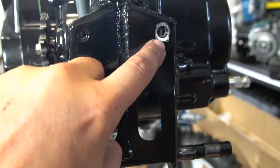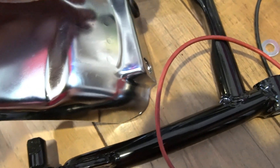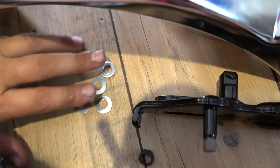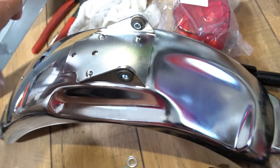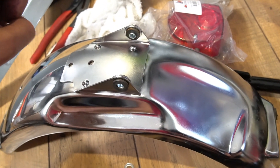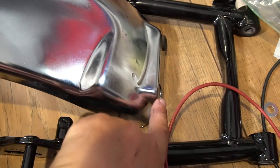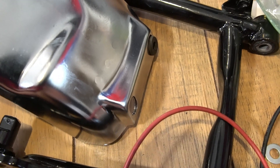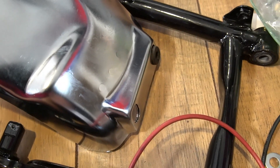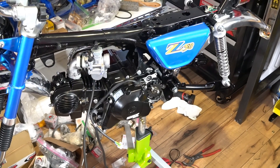When mounting this fender, I cleaned up a little area on the back lower mount so we have some bare metal from the powder coat. I modified the bushing or grommet going there because I'm going to use some spacers with washers to help create continuity from the tail light. The way I'm wiring it, I need full brake light functionality, so that mount will be the pathway back to the frame ground. If you're doing something similar, be aware you'll want to create a pathway for the rear tail light ground back to your frame.